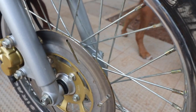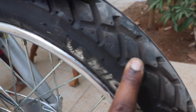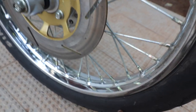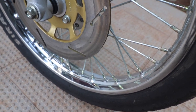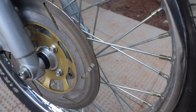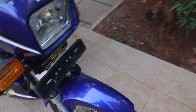When you are looking to buy one, the first thing you need to look at is the condition of the tire. The size on the front tire was 2.50 — I have an upsize, a 2.75. Then look at the condition of the rim and the spokes. If the spokes or the rims are rusted, you might need to attend to that.